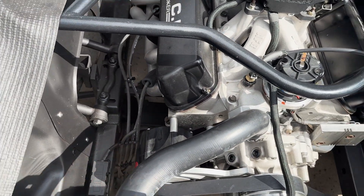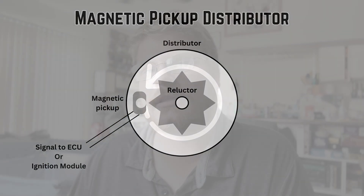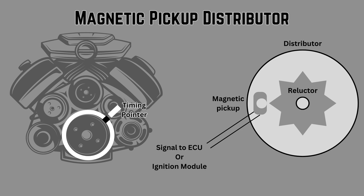The reason we set it to 45 degrees before top dead center is because we're going to have to set a reference angle in the Sniper software. The reference angle is a really important piece of this whole puzzle. In order to fire the coil and control timing, the ECU needs a regular signal for each cylinder so it can correctly track RPM, be accurate, be consistent, and not have any misfires. The magnetic pickup in a distributor provides a reference pulse every time a cylinder reaches top dead center. The problem is that if the cylinder reaches top dead center at the same time it gets the reference pulse, it's already too late for the computer to react and put a ground on the coil to generate the spark.